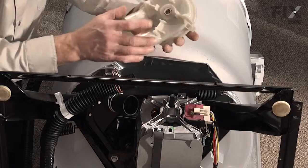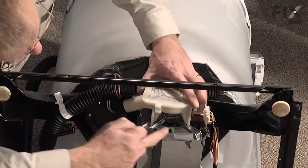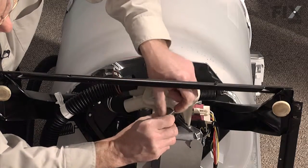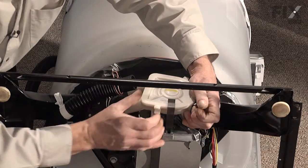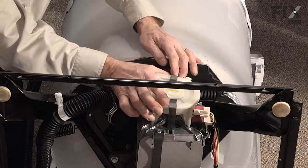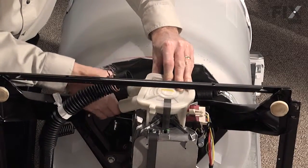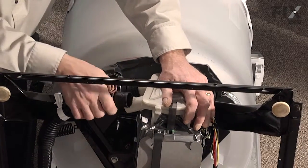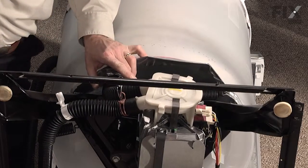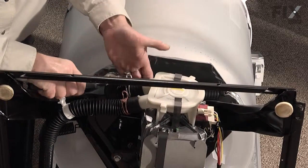You'll notice a D-shaped shaft on the motor that mates with the pump. Before we position the pump onto the motor, make sure that that shaft is lined up and that we've got the four legs of the pump set into the little receptacles on the motor. Take our clips, rotate them and then just snap them into place. Reconnect our hoses, making sure that they go fully onto the pump to the stop blocks. Take our channel lock pliers and replace the clamps.